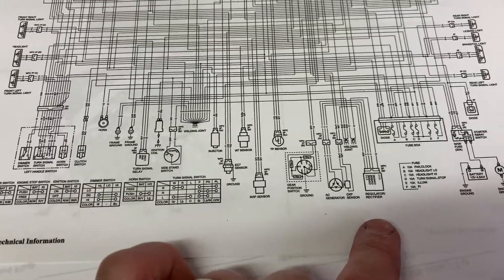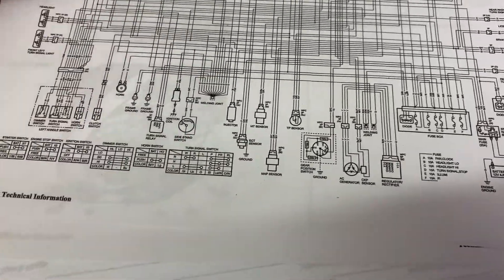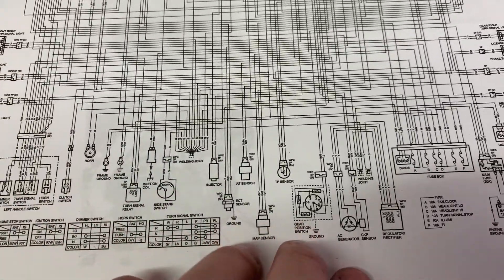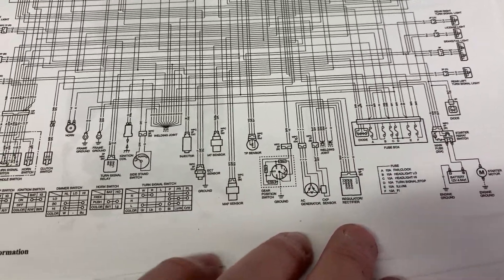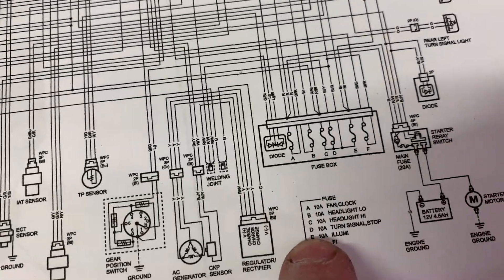So what I'm going to do is wire them both up on high to that circuit and grab my forward-looking infrared to make sure nothing is heating up in an unsafe fashion — basically give it a load test. We are using circuit D on the wiring diagram.